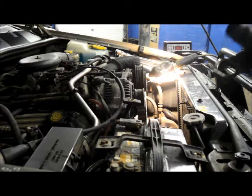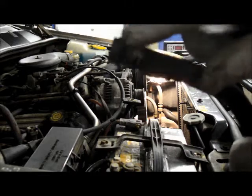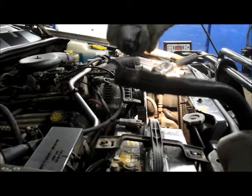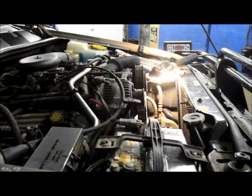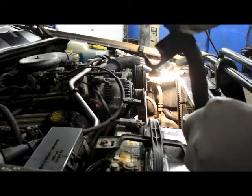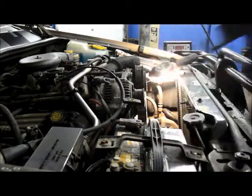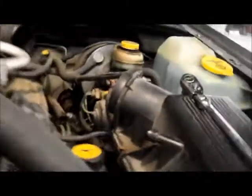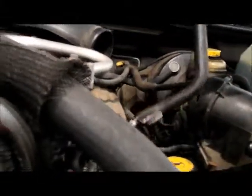We're going to take our new tube, the old tube with the new gasket right on here. We're going to put that back into the pump. What I always do is put a little dab of silicone on here also, around the whole thing. Makes it go back into the pump a lot easier, and it keeps it from leaking at all. Put it back in the way that we took it out.